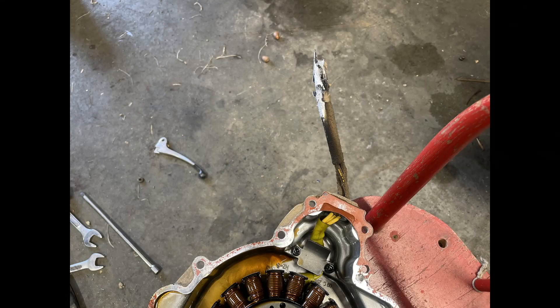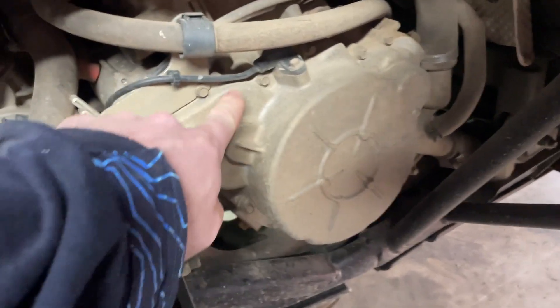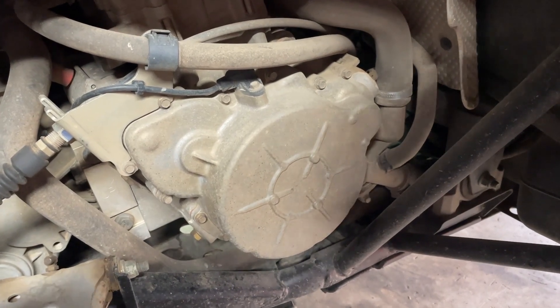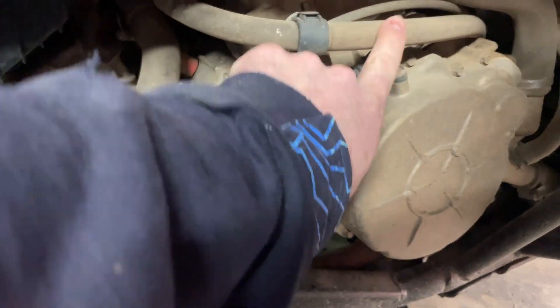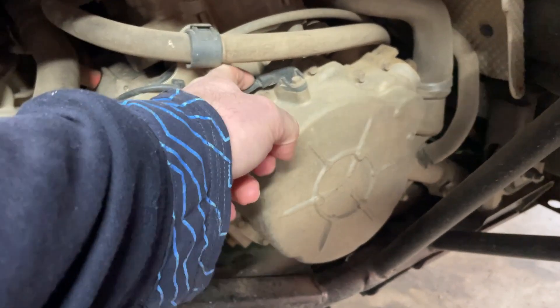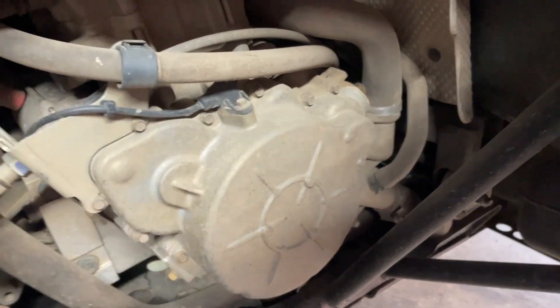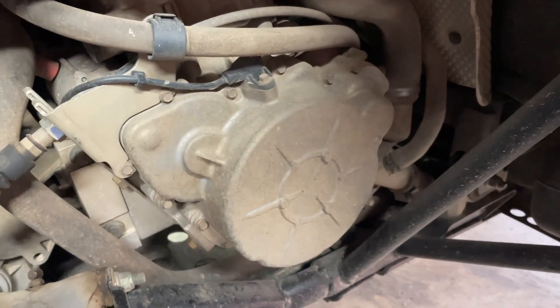In this case, as you can see in the picture, there are charred and broken wires. Getting to it involves taking this cover off here and pulling out the stator. Looks like there's a sensor on top of the motor and a bracket, but other than that it shouldn't be too bad. So we'll go ahead and start taking that cover off.